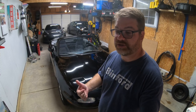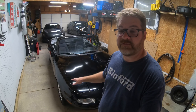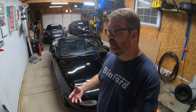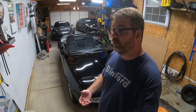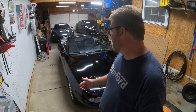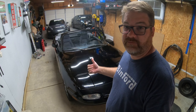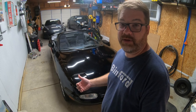I'm going to start next with just doing a clay bar, claying the entire surface, getting even more of that ground-in dirt out of the paint. Then I'm going to start evaluating individual sections, individual panels, and deciding on next steps — whether that is just a cut and polish or if I need to go deeper with a wet sand. That's what this whole video is going to be all about: trying to see how good we can get the paint on this '95 Miata.